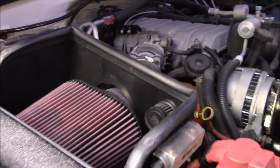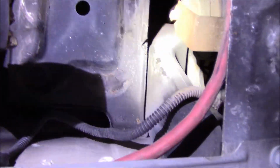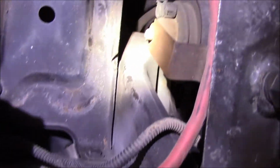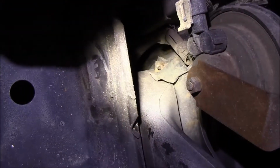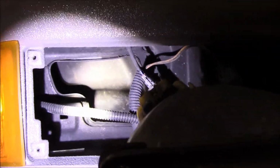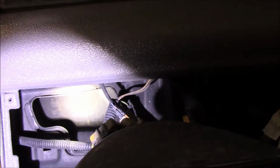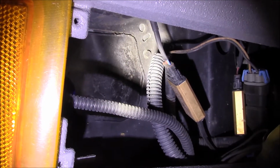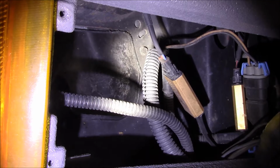We'll find out. Alright, with the battery out, you can probably see that whole plastic thing right here in the center of the spotlight. And you see right down in there, that little screw comes from the front side. So to remove it, you got to take out your turn signal. And you can see here's the intake for it right here. A lot of bug splatter in there too, which means that crap makes it into your intake. Don't know that snorkel changes that much, but there is, right back there, that little 7mm factory screw. You pull that out, and this is no longer an intake.